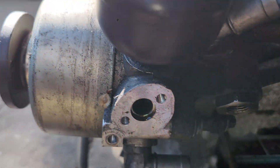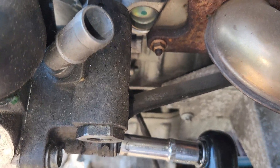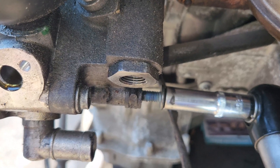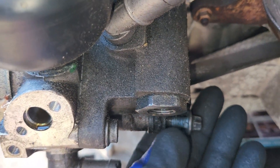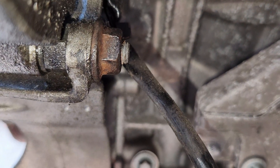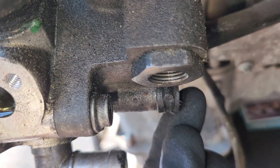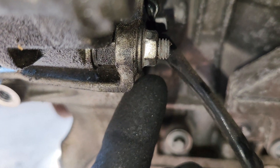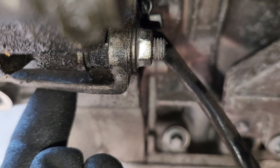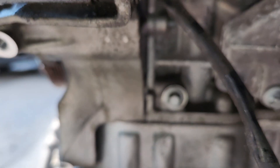I always prefer starting from the rear, so you come right here and use your E14. Once this is done, when you look closely down right here we have a 13 millimeter, so you just get a 13 millimeter and get this out of the way - it's still holding this hydraulic power steering pump. So we go right ahead and take it out. When you come right down here you can see there is a 13 millimeter which is holding the hydraulic power steering pump from the rear, so go ahead and remove that one.